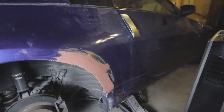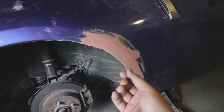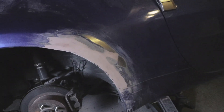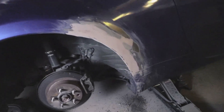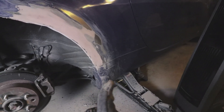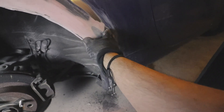I've kind of lost track of how many hours it's been since I started, but I'm on the final stages. I put on the body filler after sanding everything down, and I'm waiting for it to dry. You should wait around 15 to 20 minutes, and after that it's gonna be a final sanding. Then I wait an hour, put on some primer, and hopefully I'll be done. This isn't perfect by any means — I just did my best and I think it turned out better than I expected. I sanded it with 80 grit sandpaper and it's looking pretty good overall. Now I'm going to do 180 grit and then 320 grit, so it should be buttery smooth after that, fully blended in — because when we put wrap on this, I don't want anything to show.